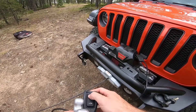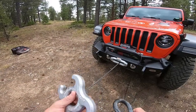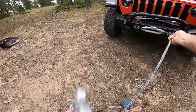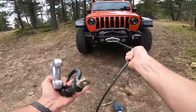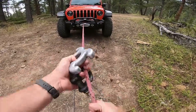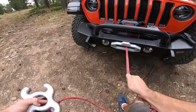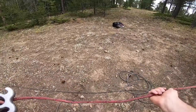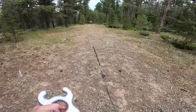So what do we do? We pop this, get some tension off, put it back in neutral, and go rig up the X-Lock. I'm going to pull all this line back out because I need to get back down to that last wrap. I'm binding up in there — I hate those little covers on these winch lines. There's my piece of tape. Let's put this back in gear — now I've got all this slack, so let's go rig this up.